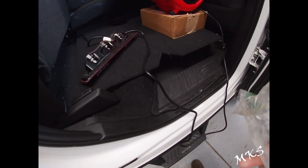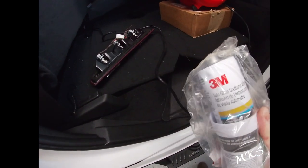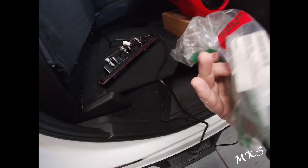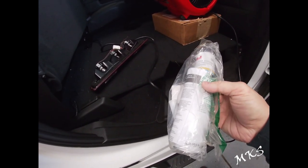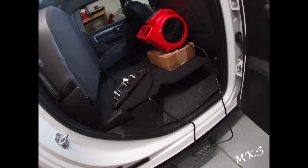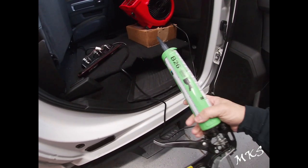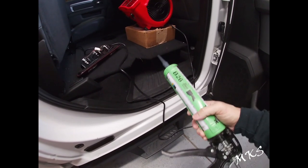So the first thing we've done is prepped our caulk gun. We've got this 3M auto glass urethane windshield adhesive — part number 08693. If you guys want to get this, it comes packaged with a little nozzle. We got these off Amazon; I'll link it in the description below. We got them in a pack of two, anywhere between 11 and 15 dollars. This is an upgraded caulk gun from what you'd normally get at Lowe's — it provides more pressure on the tube itself. Just be careful because it will split the tube if you're not careful. We cut our tube more of a V shape so you get a high bead amount and when you press the light on, it seals completely — it just squishes out.